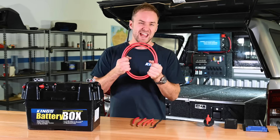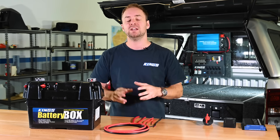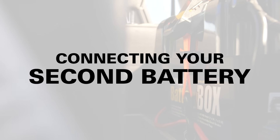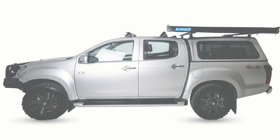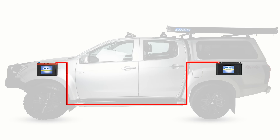That's going to involve running some heavy duty cable from the starter battery all the way back to your second battery so that your alternator can charge both. The next step is to permanently mount it and connect those fused heavy duty wires you've run from the positive terminal of the starter battery to the positive terminal of your second battery, and connect the negative to the negative.